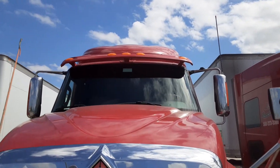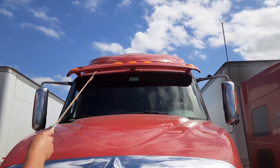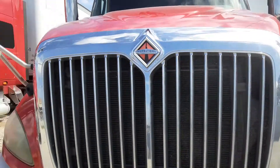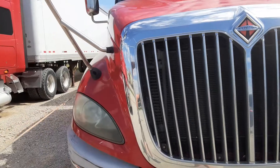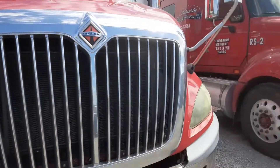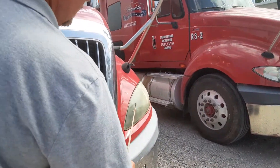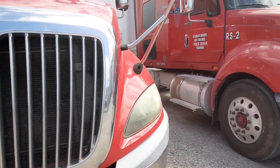Starting Section A — check your clearance and ID lights up top. Should have five of them, amber color, clean, secured, not broken, and should work. Your turn signals and four-ways on both sides make sure they are facing forward, should be amber or clear in color, clean, secured, not broken, and should work on both sides. Take your headlights — you're gonna have your high and low beam, no indication of burned out, clean, secured, not broken, and should work.